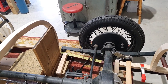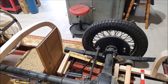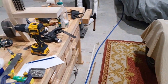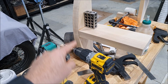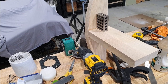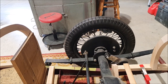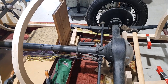The height is also nine inches, and when I set the height to nine inches that works out to be basically four inches above the top of the axle, which is what I figured the clearance would be. You can see it also puts that beam in the middle of the curve of the body, which aesthetically looks correct, and that gives me enough room around the axle including for things like the shock absorbers and the brake actuating bars.